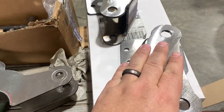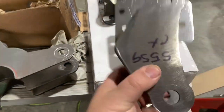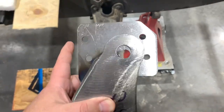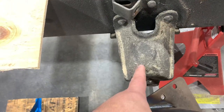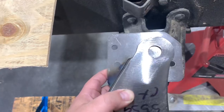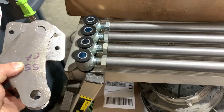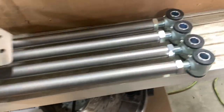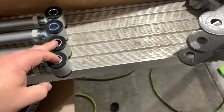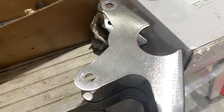What we have here are the actual frame brackets that our link bars mount to and then attach over to these brackets on the axle tube housing. Here is the reason I chose this kit — the way the frame bracket is cut and drilled, it lines up perfectly with our frame. We have to remove these spring brackets, the holes line up, this little cutout lines up right there, and we have to drill two new holes. It kind of eliminates all the guesswork as to where you're going to mount everything. It really seems to be a pretty straightforward installation. You'll mount this to the frame, mount two link bars to these two holes, come around this end, mount your axle brackets to these two ends of the link bars, swing everything up into place, make sure your axle housing is squared up in relation to the frame, tack weld in place, and you're kind of off and running.